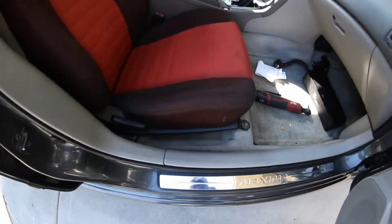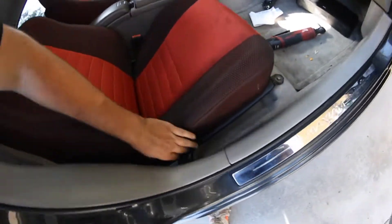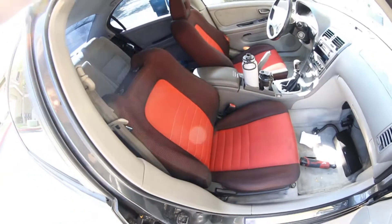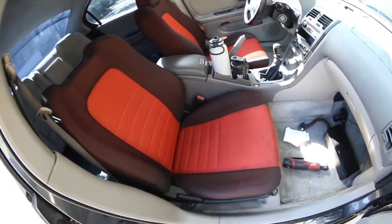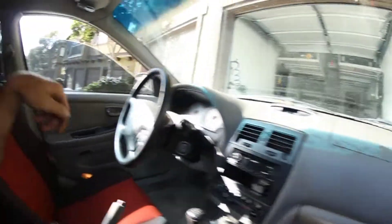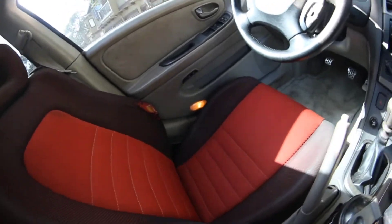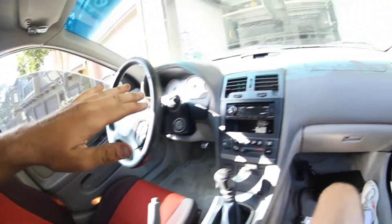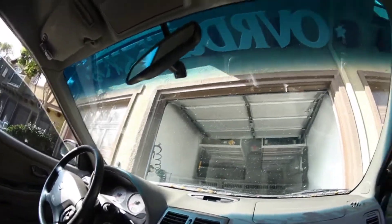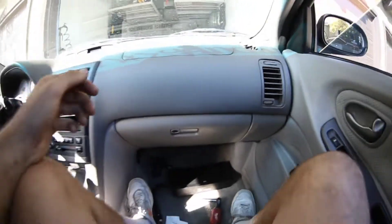Just to show you — seat fits in the car, angle and everything is proper. There it is, headrest fits as you see. Seats are basically fully installed. On my driver's side, I had to put a little spacer on it to make that side sit up a little higher. It might have just been me or it might have been the seat that's off, but it seemed to kind of angle down, so I ended up putting spacers under that and it feels good. The passenger side, even as it sits right now, feels really good — it really doesn't need to be adjusted at all.